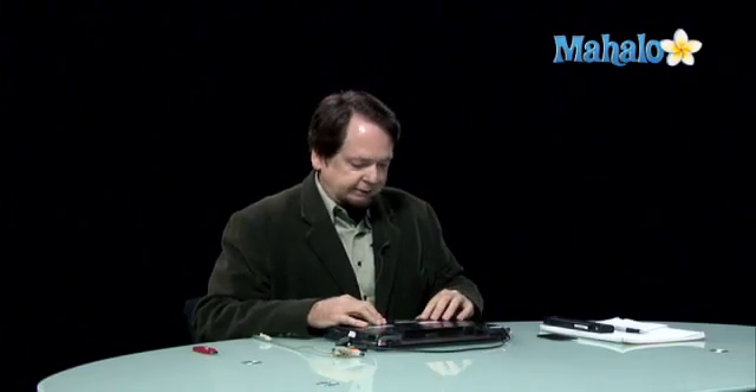Generally, your RAM will come in static packages and you want to remove the RAM carefully and install it quickly into the laptop, minimizing the chance of any static exposure. If there are metal objects nearby, go ahead and discharge yourself to any metal on the chassis or nearby. Once you've done that, you are essentially static free.